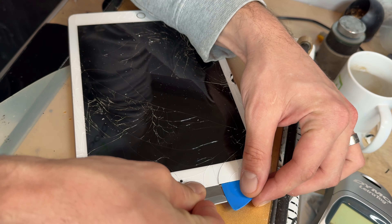Now that we've got those three edges separated, we're going to lift it up and open it up like opening the back cover of your favorite book. Now that it's opened, we're going to take it back over to the workbench to begin disassembling. I'm going to place a mug or another heavy object just behind the screen to stop it from falling over and breaking any flex cables — most importantly the Touch ID flex cable — and then we're going to use a crosshead screwdriver to remove the four screws that hold down the LCD.